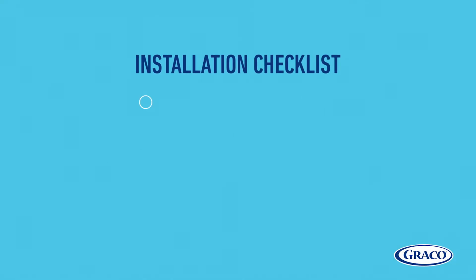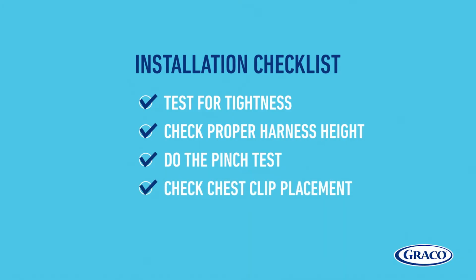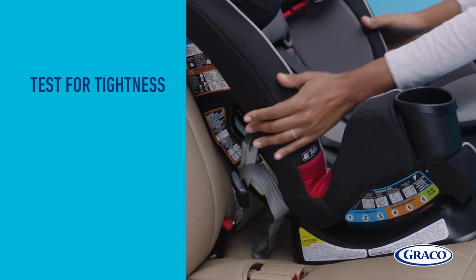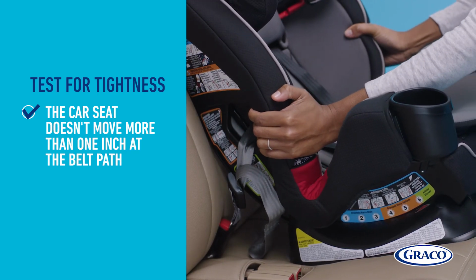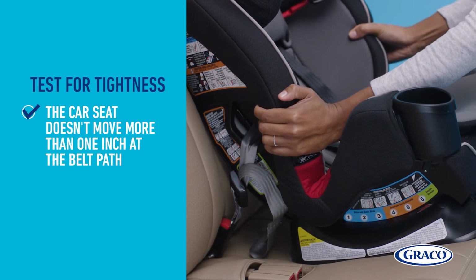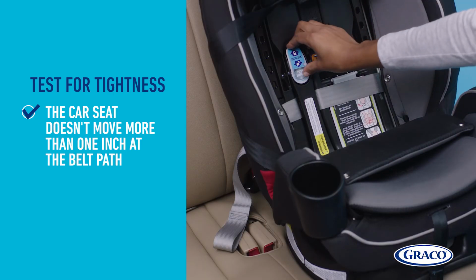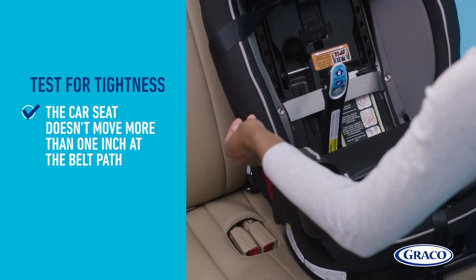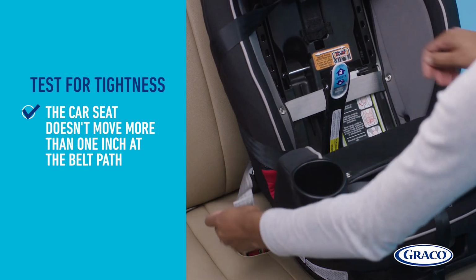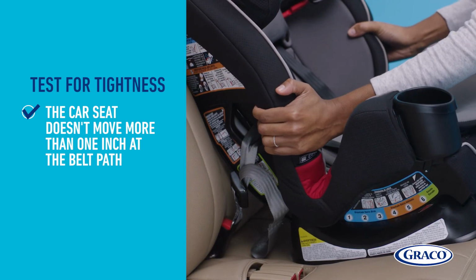Finally, go through this checklist to make sure the installation is correct. Test for tightness. Grab the sides of the seat where the latch strap is routed and slide the seat side to side and front to back. The seat shouldn't move more than 1 inch in any direction. If the seat moves more than 1 inch, open the SnugLock lock-off and pull on the latch strap to remove slack. Then close the SnugLock lock-off again. Repeat until the seat moves less than 1 inch.